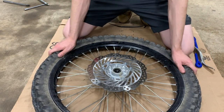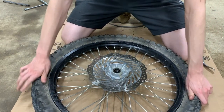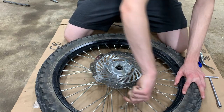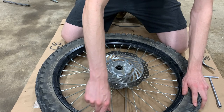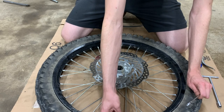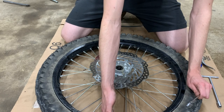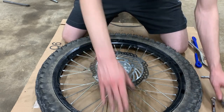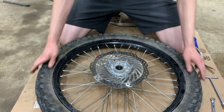That smells like formaldehyde — if you ever dissected animals in science class back in middle or high school, that's what that air smells like. Kind of gross. Something I did before I got to this point was I aired down the tires to just over 10 PSI, and then I just drove around my driveway doing some tight low speed circles for three or four minutes — long enough to let the tires really squish and squash around to make them a little more pliable.